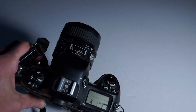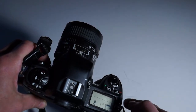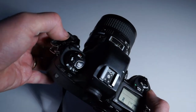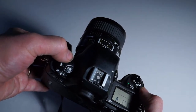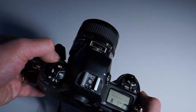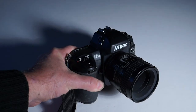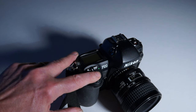When you get to the end of the roll, these cameras are supposed to wind the film back into the cassette, but often don't. On this one, you'll see a little film roll icon with a couple of arrows — you have to hold this button down and also this button where you also see the film roll icon, and then it manually winds the film back. You'll notice it because you'll be at around exposure 25 or 26 and the camera will just be grinding away for a minute. If it doesn't do that automatically, hit these two buttons to make sure it does. Otherwise, shooting is fully automatic: turn it on, push the button halfway down for autofocus, push it all the way down to take a picture, and it automatically advances the film to the next exposure.